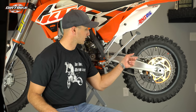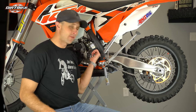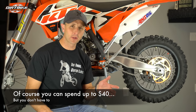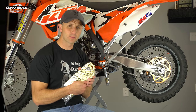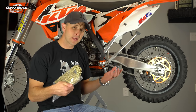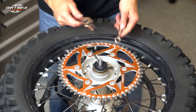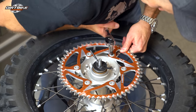The plan for today's project is to do this in three steps. First, take off our rear tire and replace our rear sprocket. Next, we'll move up to the front sprocket and replace that — these front sprockets are pretty cheap, you can get them for around 10 bucks. Then last, we'll reinstall our wheel and break down our chain and install this new primary drive gold X-ring chain, which I think is a pretty big step up in quality. So that's our three steps: first back here, second up front, and then third, the chain.